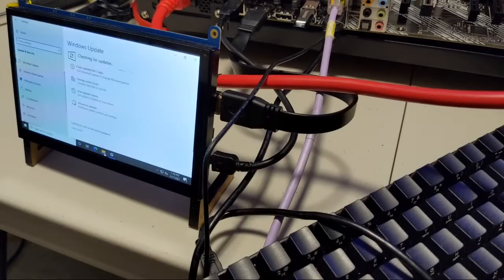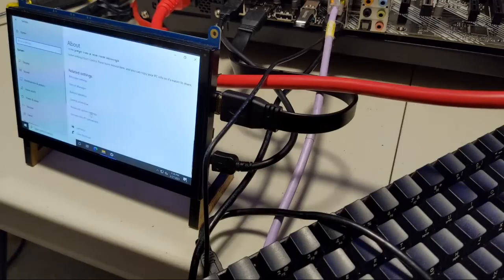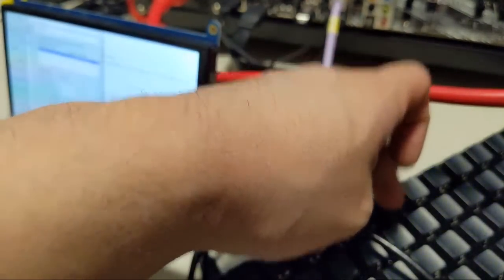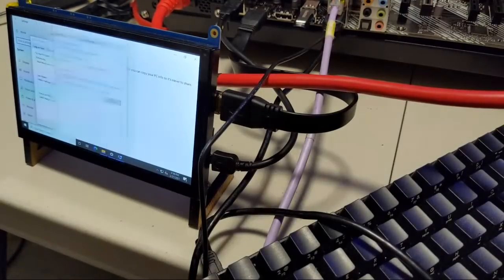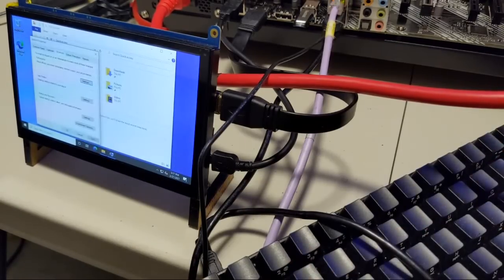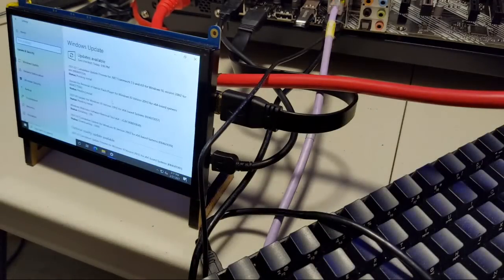Okay, and we're gonna have to enable, we can do it now as well, the virtual memory. We're gonna add the virtual memory, so we have to go to system, advanced system settings, performance, advanced, change. We gotta add more virtual memory here. So I think 60,000 is good enough. Let's do 60,000. Set. Okay, and I can't even press okay because it's too small. Oh my goodness. Can I just press okay here? Really? Hold on. There we go. Let me just verify. Yeah, 60,000. Okay, good. All right, let this Windows update first, and we will restart.